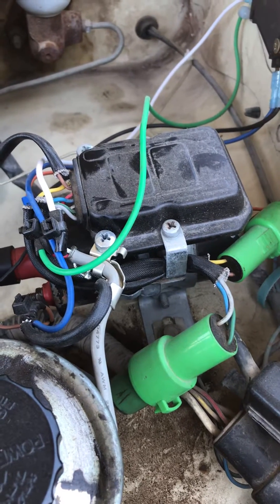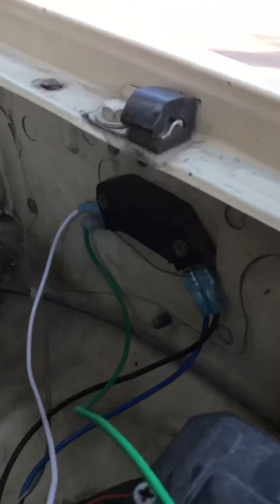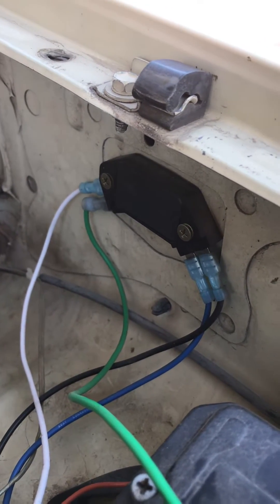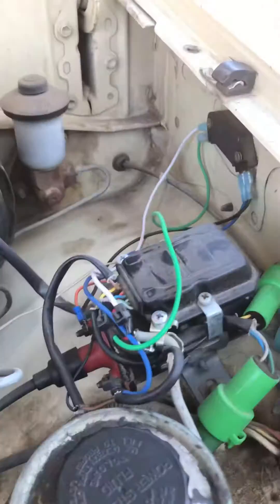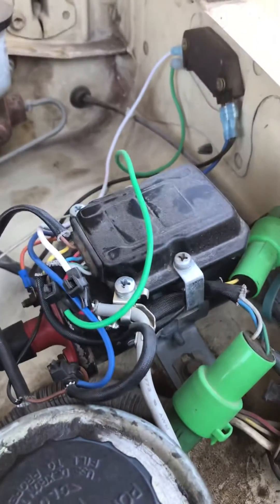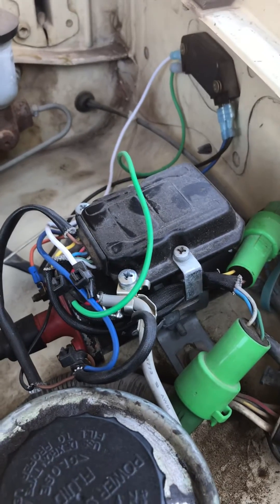Finally saw the trick on the GM igniters online. I left it this way to ensure that it was going to work and solve my problem. So I wired in the GM EFI igniter on top of the Toyota igniter, because if I tried to eliminate the Toyota igniter from it, the truck was not liking that.